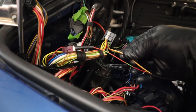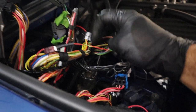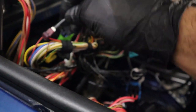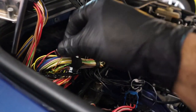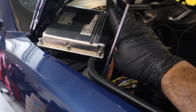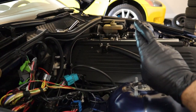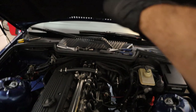There looks like something I could push in or out to slide that clip out, but my main concern is I don't want to break anything — so I'm going to gently work on this. Got the plug back in. The MAP sensor goes to pin 18, ground goes to pin 16, and then for power you trace the pinout from pin 7. They provide you with this clamp that clamps onto the powered wire itself and then plugs in. That is good to go. Now I'm going to grab my DME with the CSL tune, plug that in, get everything stuffed back in, put the airbox back on, and start it up — fingers crossed everything goes good.